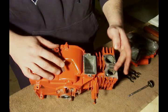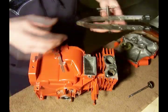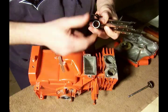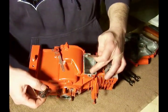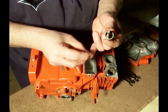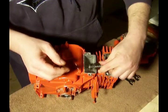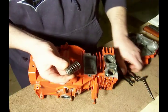Now it's time to install the valves. First, let me show you the tools: this is my valve compression tool, this is the valve spring, and this is the part that locks the valve in place. Inside the valve, the spring is going to be on here, and this part looks like a little keyhole. The valve is going to stick through that hole and sit in the center, locked in place, and that will be inside this hole. But to do that, we need to compress this spring, and here's how we're going to do that.